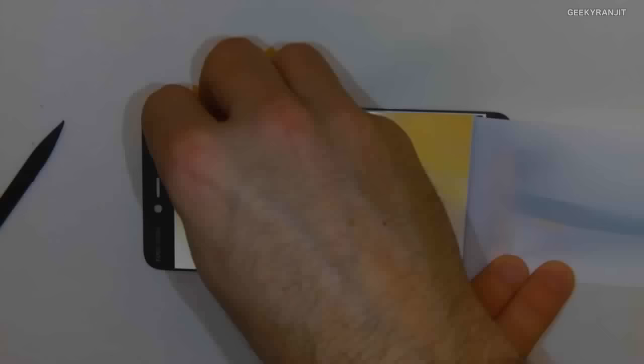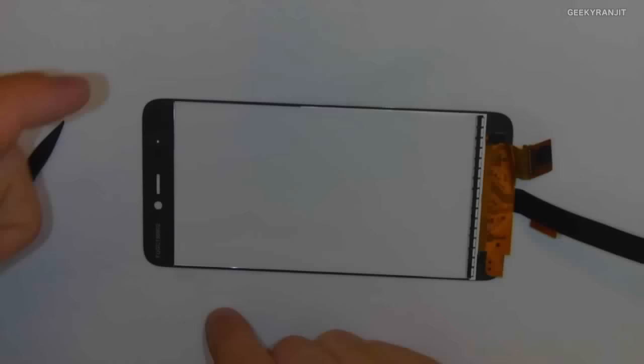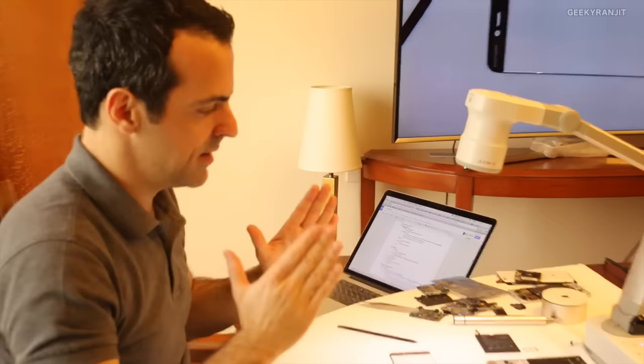So I'm going to stop peeling here, because it becomes really, really hard. Yeah, and not good for your fingers. And the next layer down, right, so the diffuser, the prism, and then we're done with what's called the backlight unit. Basically, these five layers that I just talked you through, all they do is get light that's coming one way to go straight out through the phone, basically in parallel rays of light. Right, so you've got beautiful light coming out.